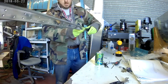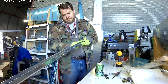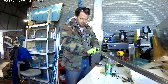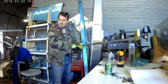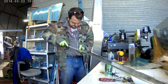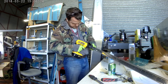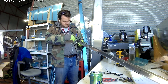You really need to make sure that all of your electrical wiring is grounded safely back to a main ground. Normally you could just have one wire leading all the way out to your wingtip — you plug in a landing light and ground it to the airframe as the return. But then you're pumping 12 volts into the airframe, which causes huge electrical disruptions. Instead, you have the return line go all the way back to the source, so there are no static loops.